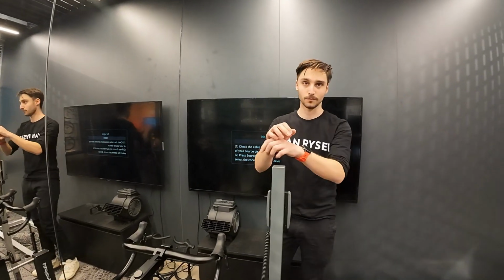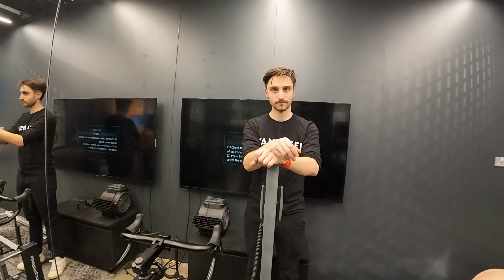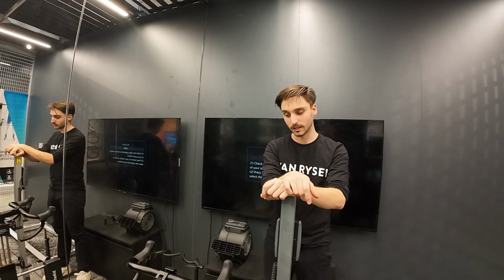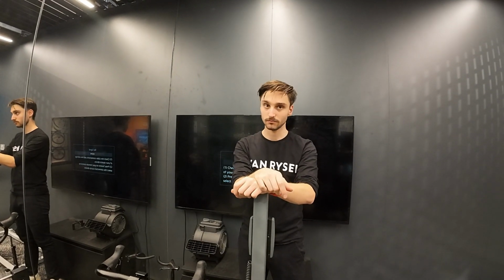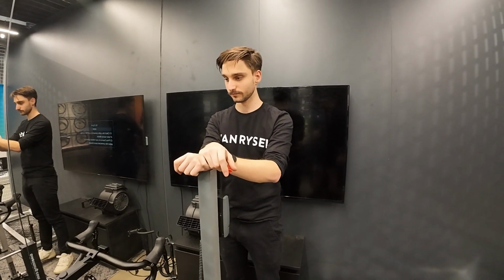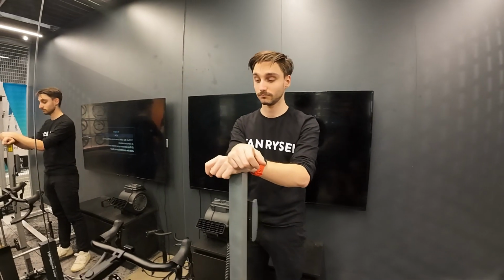That's why I'm thinking my leg is going too high while I'm pedaling, when the pedal is in the top position, so maybe the angle is too high. That was my consideration, or maybe I should go for the shorter crank. I mean, we can quickly try a 165. I will first try this setup, and then like I said, I'll give you updates, and maybe we can try for half an hour, riding on a shorter one. We will see. Okay, lovely.